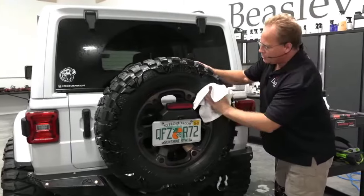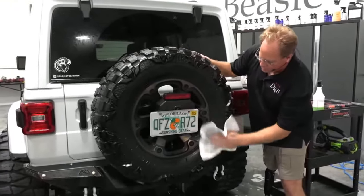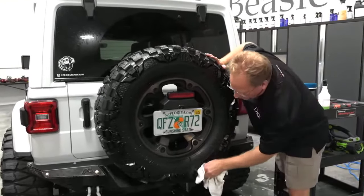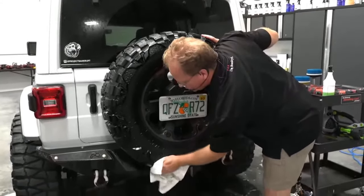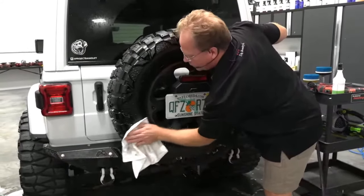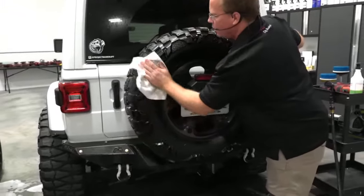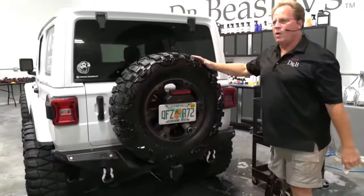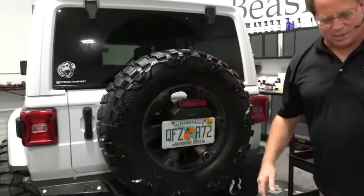So what I was telling Yancey was, I like tire coatings, but only for specific types of cars, like that 1970 Cuda back there. That's got your iconic BF Goodrich TA radials with a smooth sidewall. And if you machine scrub that, get it really nice and clean, and you put about 5 applications of the Tough Shine tire dressing, they will look like wet plastic, dry to the touch. Kind of like this. This is actually a very deep, dark black look.